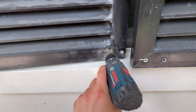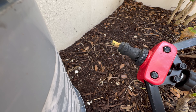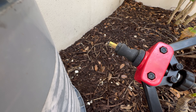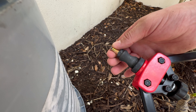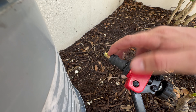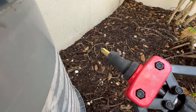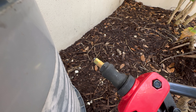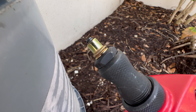Before I put the bolt in, I like to squirt some grease in there. If this rivet is slightly bigger than the old one, or the hole is slightly corroded, you might need something to just barely ream the hole and knock a couple of burrs off — but don't overdo it, because you want that hole to be as tight as possible for a good connection. I also want to show you: the rivet nuts that come with this tool are steel, so they will rust out in time, especially here on the Treasure Coast where there's a lot of salt in the air.